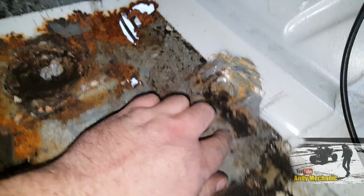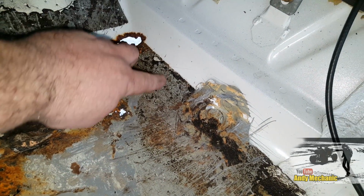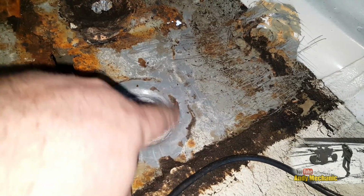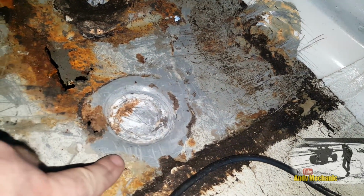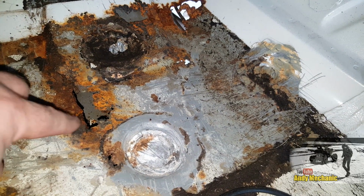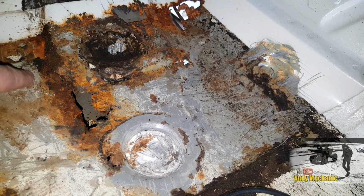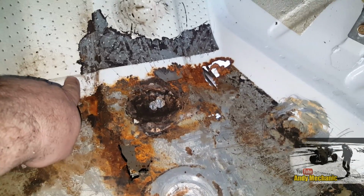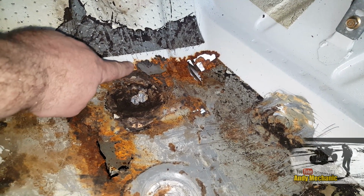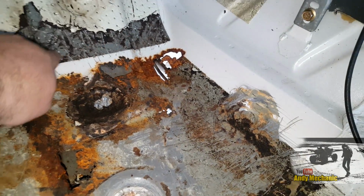Quite happy with that. But I think what we'll be doing is bringing a triangle of steel across down here, past this circular bit, just to make it easier to weld, round the back of here, up this side. Again, on the good stuff, I want to stay well away from anything that's brown because it makes it just impossible to weld. So we'll bring it up here, up onto the firewall, and then maybe 30-40 mil above this corrosion point up onto here, and we'll weld onto there.